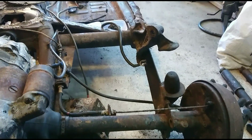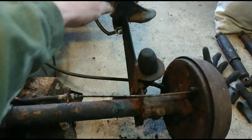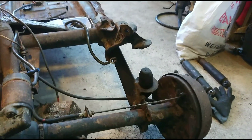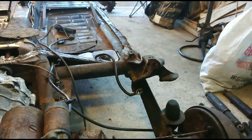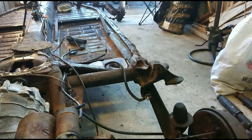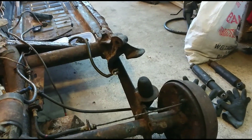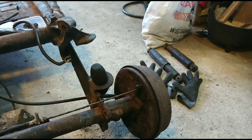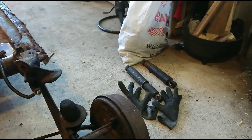I've been on it about 25 minutes, half an hour - not long at all. One shock bolt undone, I think it's a 19 and a 17, same at the bottom and on the left-hand side. No nasty surprises. Considering I don't think the car's ever been this apart before, they came undone really easily. The shocks look really manky but they've still got quite a lot of compression in them - whether I replace them or not, more than likely, because they look awful and I'm assuming they're pretty old, but they came off okay.